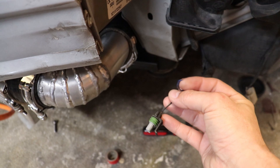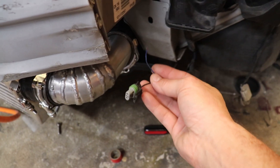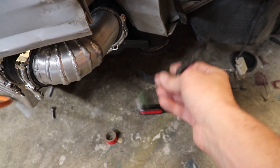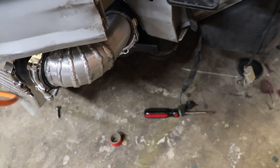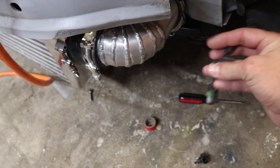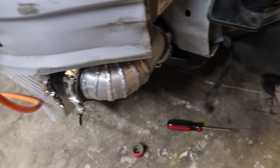We also still have the NMB2 — it's basically a two-step programmer that I need to install, but we'll do that later down the road once we get the thing under boost. There's also this little wire here that fell out — it normally plugs into the front bumper and is part of the intake air temperatures, basically gets a reading of the outside temp. This thing dragged on the ground and tore out one of the wires, so I need to sort that out as well.